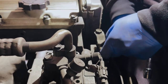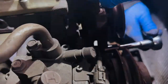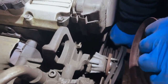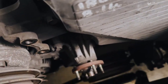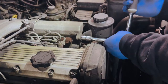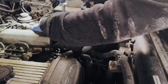We're now going to take the tensioning pulley - this is the aircon belt actually. We can take this pulley off the water pump to take the alternator belt off. We'd be adjusting the alternator tensioner obviously when we come to put the new belt back on. We're also going to take the power steering reservoir off and just leave it loose, just so it's out of the way so we can get to the clips for the cover on the timing belt.